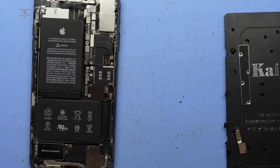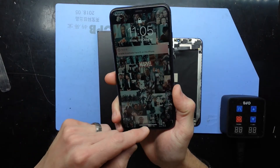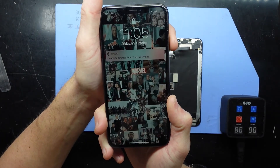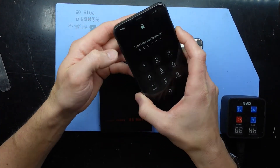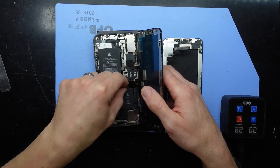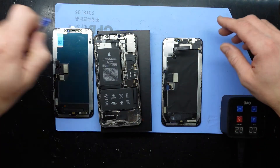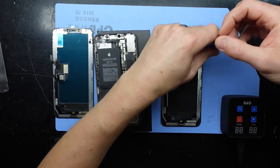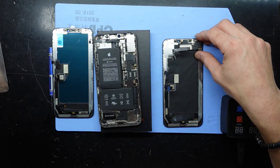I'm going to do a bit of comparison. The quality of the new screen isn't as bad as I thought, but the biggest thing most people will notice is the screen lighting up fully rather than partially. My biggest concern is the difference in voltage and power supply required — it should be made with tolerances in mind, but there is definitely potential for board issues when it's trying to drive an LCD as opposed to an OLED. There would be some difference considering it doesn't need to constantly run a backlight, since there isn't one.